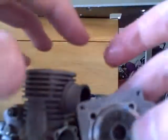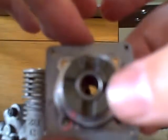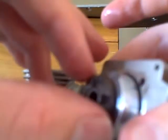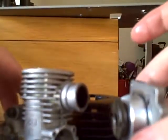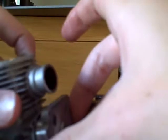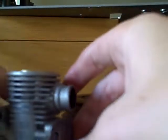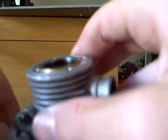The one safe way to figure out which one's the one that your car hooks up to is you could see where it's worn down. You center that on top, making sure this notch right here on the back plate is up, because otherwise your piston will come down and crack. Put your piston in line with your one-way bearing. Turn the motor over. You'll feel it kind of pop into place a little bit. And you cycle your motor a couple times.